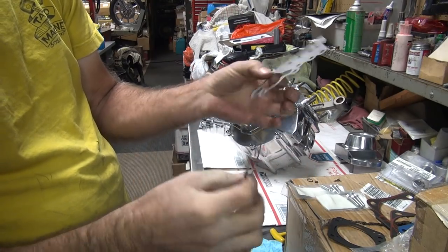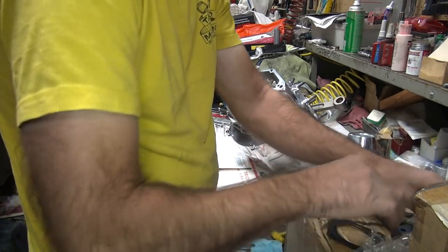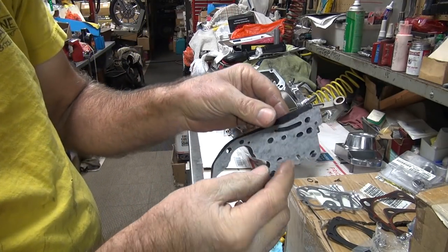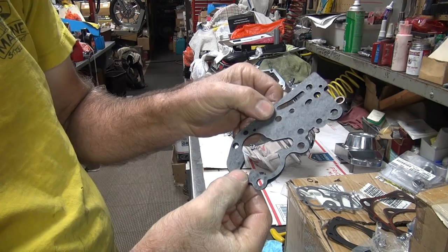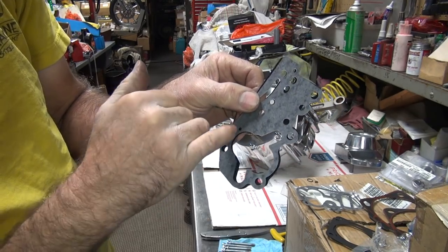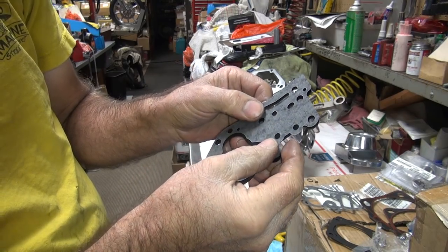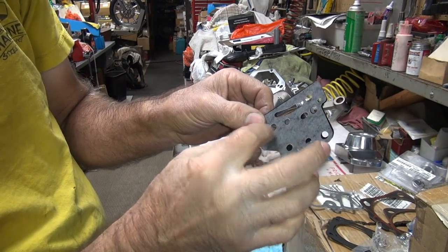Just like any other gasket. What happened to the other gasket we already had out? Okay, this is a James stock gasket — stock shovelhead gasket. This is an S&S gasket. So what's the difference? We don't have these two holes over here. The little one's a chain oiler. Those all line up. We don't have this hole right down here, or this hole over here. These two holes aren't here, but these two here line up good — holes, no slots.